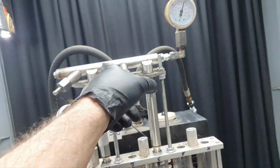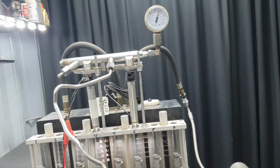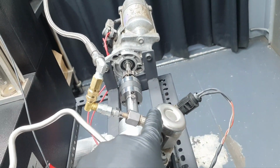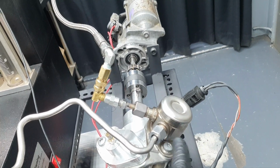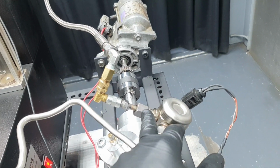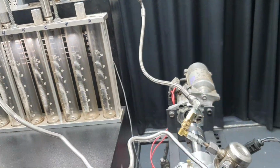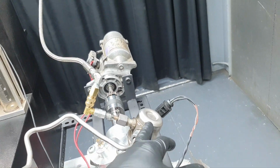If you have a long cranking and you don't have pressure inside the fuel rail, put the diagnostic tool on before you start the car and you see 7-8 bar fuel pressure. How much is the low pressure pump gonna give you? Not even 7, okay, 5 to 6 bar. That means either you have an injector leak or the check valve on the high pressure pump has failed. It's not here, sorry, the check valve is supposed to be here. I have opened I don't remember how many pumps. Here has a screen, here has a filter, here has a check valve. So from this side, this line and the fuel rail, it's supposed to be at 100 bar to start the car easily. If not, either it's a leaking injector slowly dropping the pressure, or the check valve failed and it's giving the pressure back.